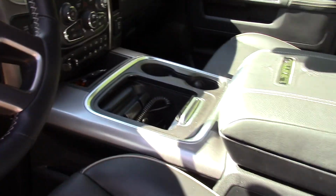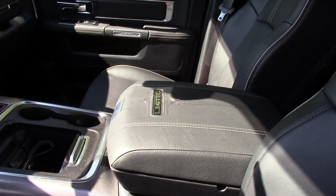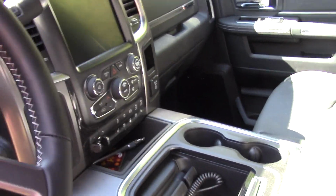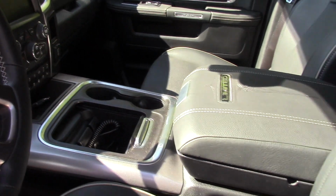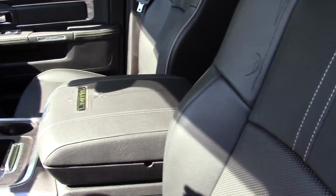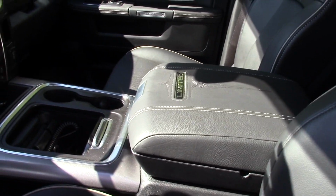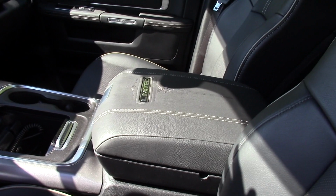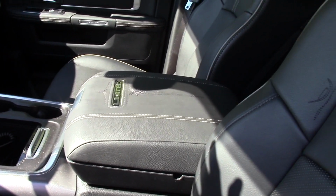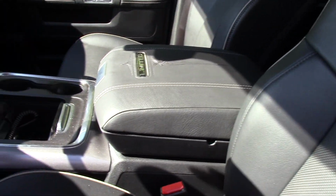The brake controller on this works 1000% better than the old truck. There's actually a couple of settings. You have the normal gain settings, and then you also have a light and heavy electric mode, and that works really well. In the old truck, with this particular trailer, I was basically at the max gain, 10 gain, and I'm in the mountains, so you were in 10 all the time.